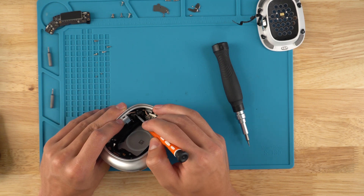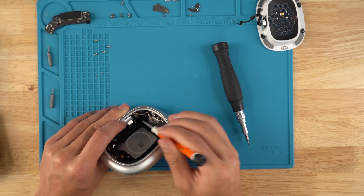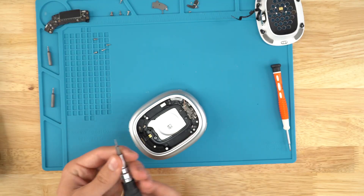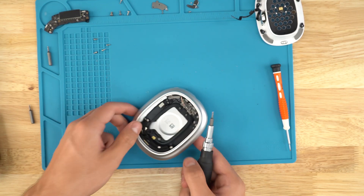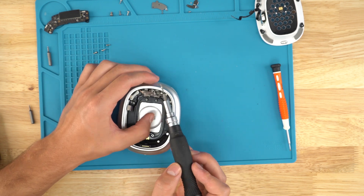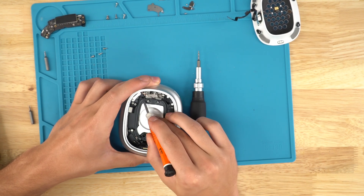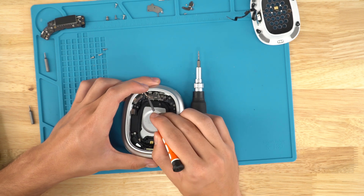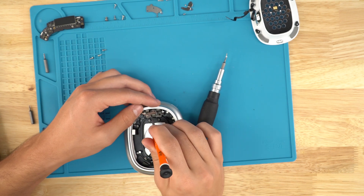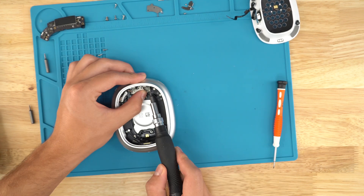Okay, now that it's down below, I'm going to clip it in. This part is kind of tricky to show. You can hear I just clipped it in, so time to screw these screws back in. Switch to the T5 bit and get the big ones on that hold the jack to the housing. There's a little dilemma here — the ribbon underneath is kind of getting in the way, so I'm going to pull the jack out slightly and then push it back in after getting that ribbon out. Time to screw this back in.